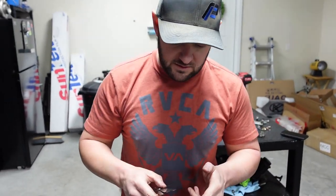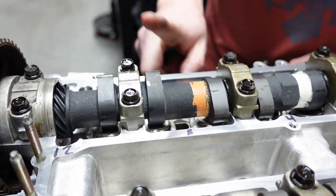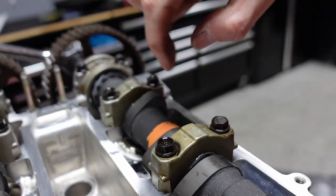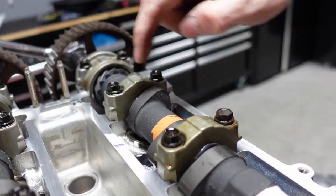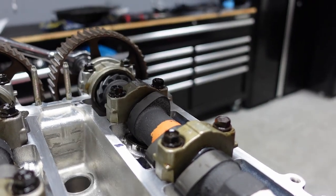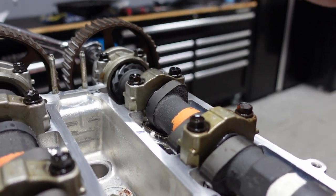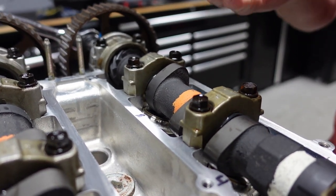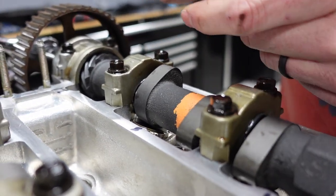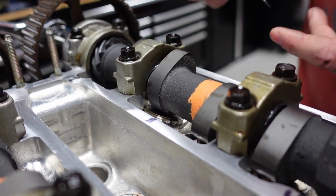Now, if Colton comes down here, you'll see the cam lobes. You're going to want to have the cam lobe slightly faced out right now. So if you come over this way, bring the camera towards this direction here, and if you're shooting in, you'll see the base of the lobe itself. So here's the top of your profile. Here's the base of the profile of the cam. From that base of that profile of that cam, we want to have 10 thou clearance. The reason for this is that is ideal without rubbing and is ideal for kicking out that shim. That shim that's inside of that bucket could be spit out. We don't want that to happen. So to keep that from happening, 10 thou is ideal.